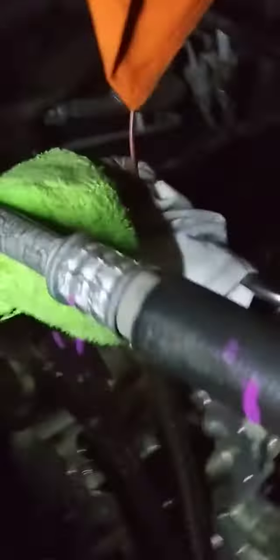Let me show you what I did. Don't worry about the factory marks on the timing — sometimes it's hard to find them. I made my own mark, a little mark right there. I put a white mark so I can put it back in the same position. It's no problem with any car — if the timing changes, make your own marks or you're going to be in trouble.